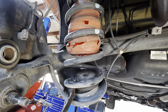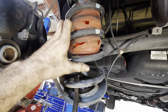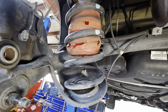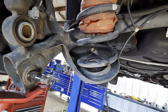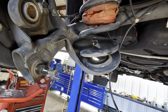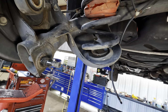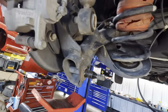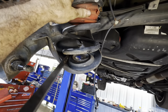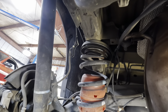Let's pull this little puck out — this thing is necessary and will need to be replaced. I think that's all she wrote on the downward travel. I'll lift the vehicle up some on the rack — maybe that'll give me some more space. Moving on up... oh yeah, it's working. The axle is fully in a dangling position — 100% dangly. So now we're going to go in with a pry bar and work this spring out, maybe from up top.